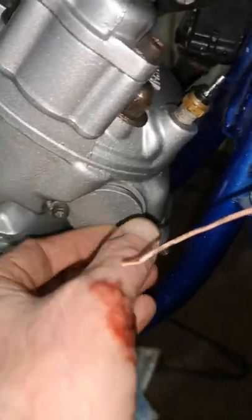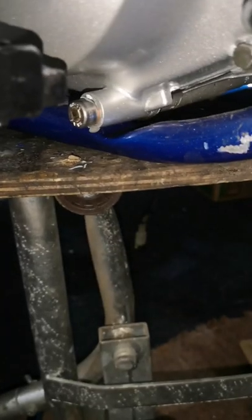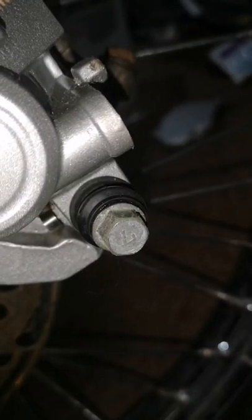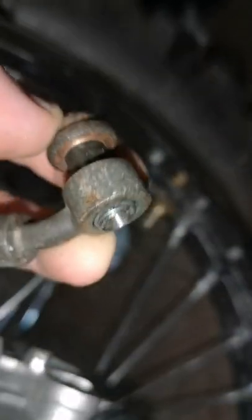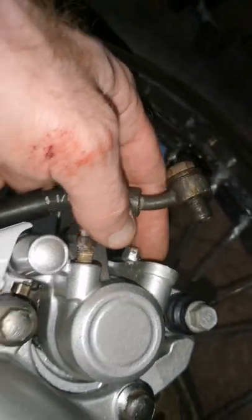That's that bolt Loctited in, just I've had a couple of them pop out. Loctited the kickstart. So that's a sump plug in with the copper washer. Got that bolt through the front brake, so the caliper's all on now. Just need rigs up. I think there's a copper washer on the top. I need a copper washer for the bottom and put it into there for the front caliper.